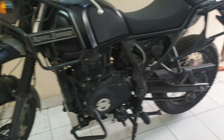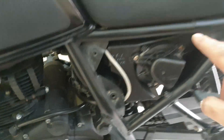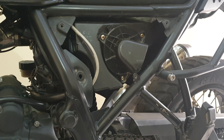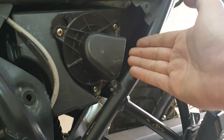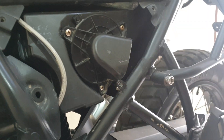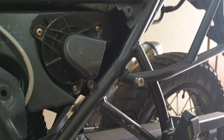What I wanted to share today — and maybe some of you have had this problem too — is where this air scoop is located and how it is positioned. There is this opening here, and if you enter deep water while traveling at speed, the water gets thrown back, gets sucked in, the air filter gets wet, the bike stalls, and then you have to drag it out.